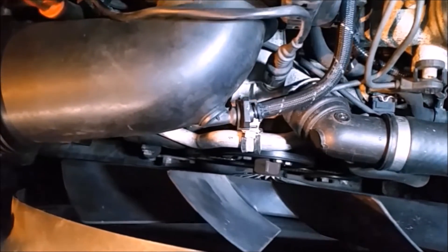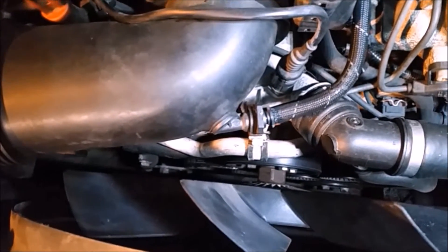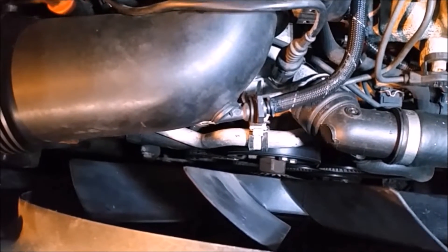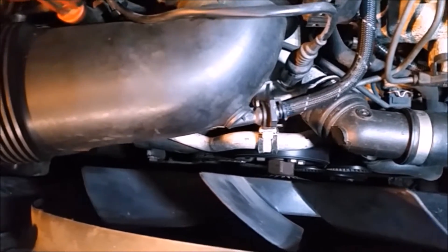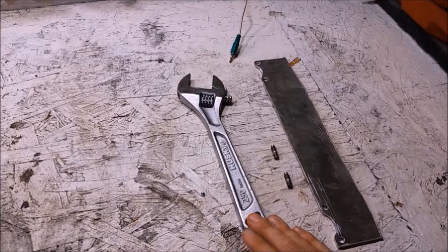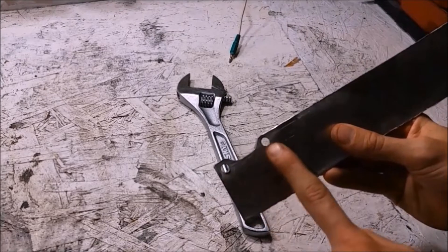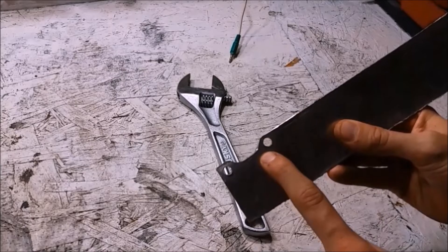To install this, we're going to have to get a 32-millimeter wrench on that nut and hold the water pump pulley still to take the fan off. It is reverse thread, so you'll be loosening it to the right instead of the left like normal. They do sell a specific tool for how to take the clutch fan off, but basically I just copied it for much less. You'll need a 32-millimeter wrench or an adjustable wrench.